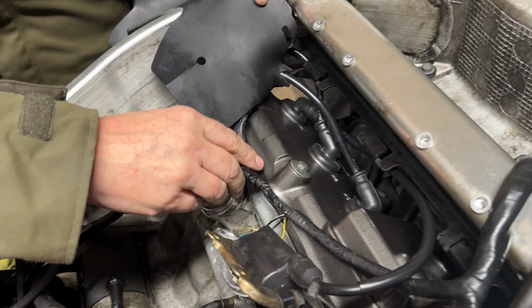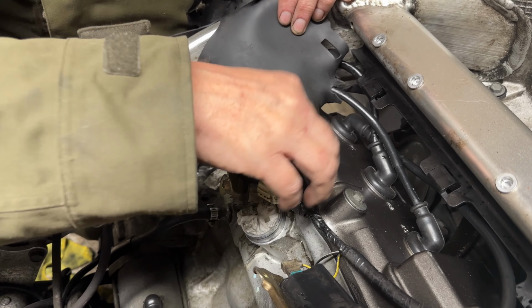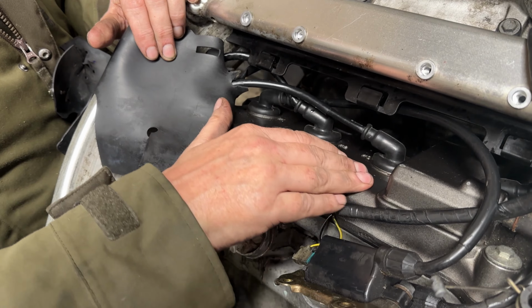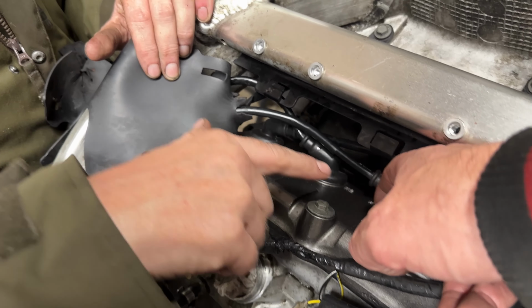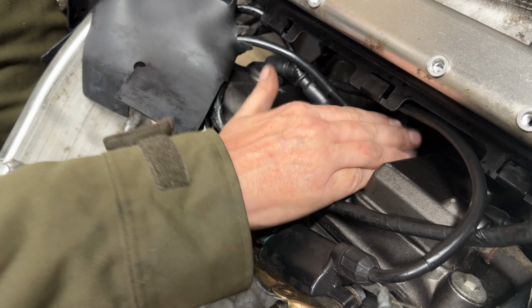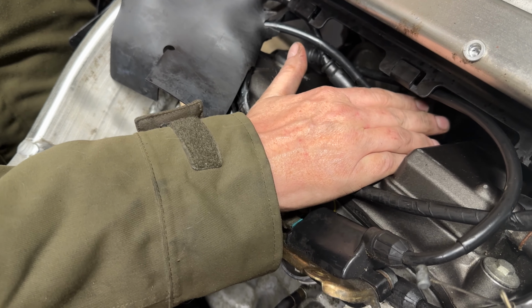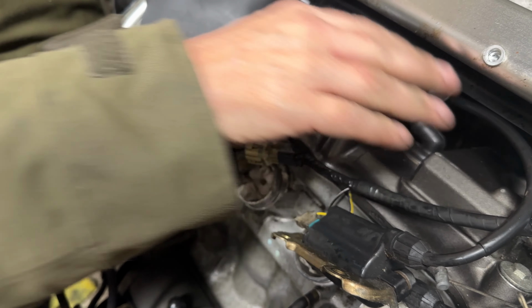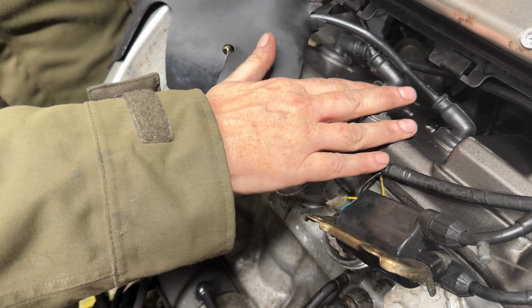Now, obviously, whether it will fire on all four, we've had an interesting discovery when pulling out the spark plugs, with the third one being rusty. So that's going to be interesting. I found that these may not have been pushed down fully, so I've made sure. And that might correspond to the rust that you've seen on the video of one of the carbs that seemed a bit dry compared to the others. But anyway, new plugs are in.